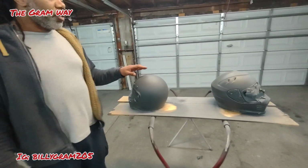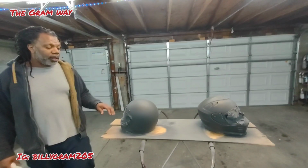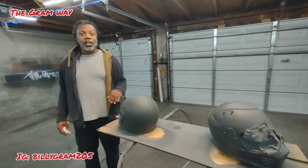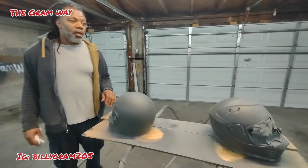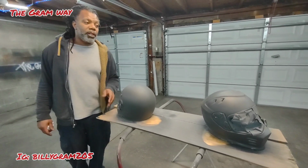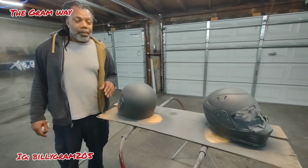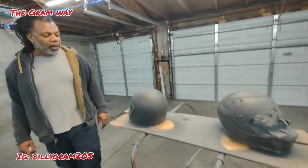That's if it's matte or satin clear. Right. Yeah, it comes too thick in there. They don't be understanding. And they do not tell you on the side of the box, like, you may have to mix down, or you may have to add this, you may have to add that. You need some thinner or some mineral spirits added to it so you can spray it out of your gun. And they want you to spray it out of a 1.2 to 1.5. And we did that. Oh, I did that. But it did not work because it's too thick. Yes. We gonna fix it, though.